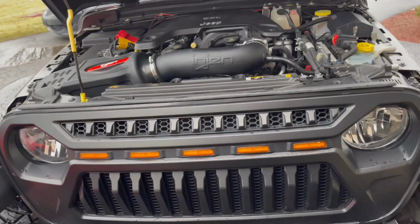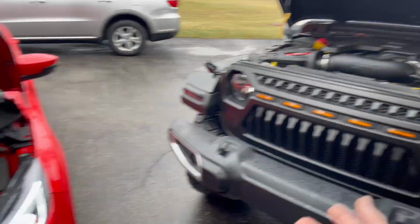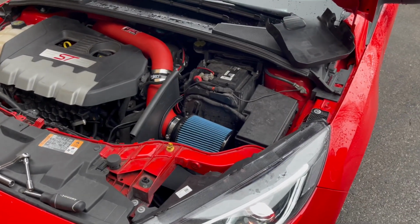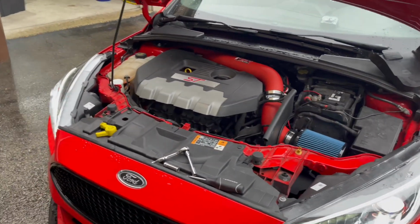So we were cranking, nothing. You know, it was cranking slowly. So of course, we're like, oh, maybe the battery's dead. We were charging it up, but it looks like we disconnected that ground right there, the engine ground, and it was very, very loose, you could hardly tell unless you wiggled it. Tighten it down, and she started. So now let's hear what it sounds like.